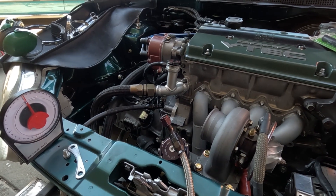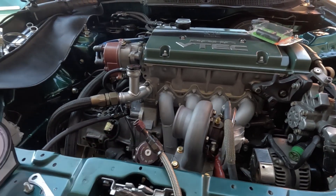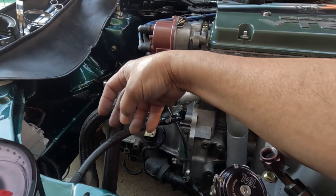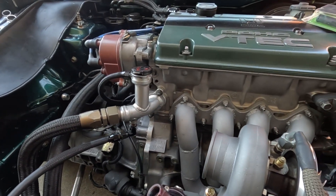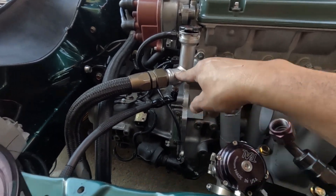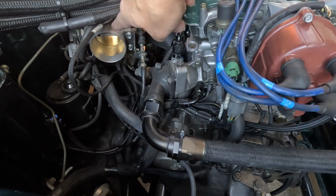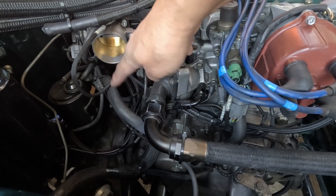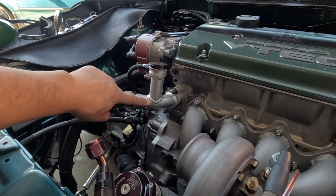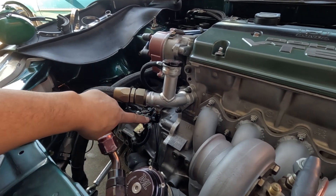Let me show you how I ran my water coolant in the past. I did some research and figured out that when the engine is running, the water pump sucks cold water from the radiator and pumps it out in one direction — also pumping water to the IACV line, which returns to the thermostat housing on the cold side. Since there's a steady water flow going back to the radiator, I decided to weld a fitting and connect a water line there.